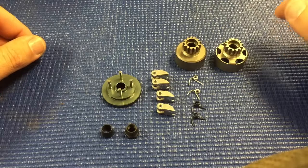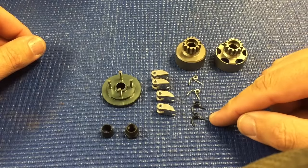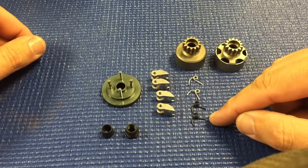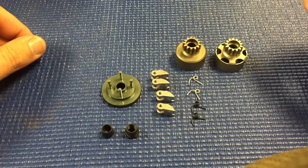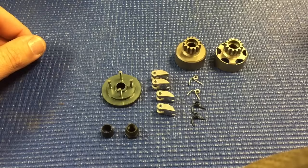For truggy, I would still stick with two soft and two hard shoes, but I would run all four .9 springs. And if you're on a really low grip track or you have an engine that doesn't have a very good power band or is just really erratic, you may want to run all four .8 springs. This is available now at MugenRacing.com.